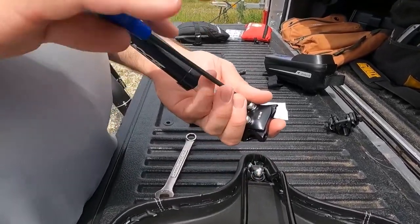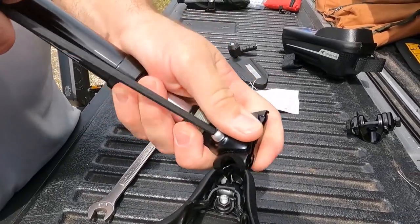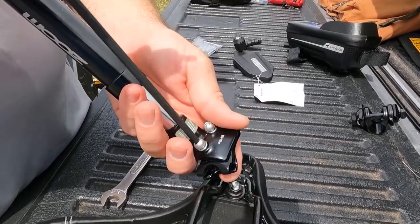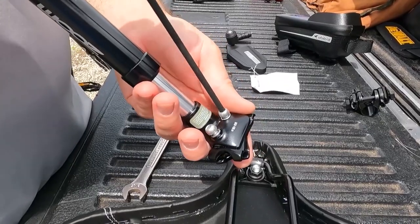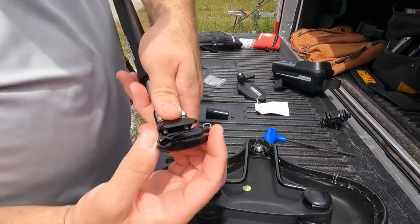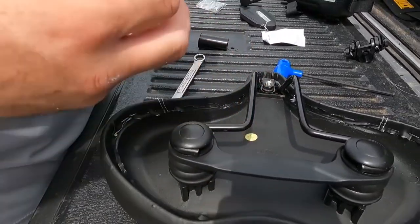See? Bought this for the brakes, but it fits a lot of stuff on this bike. Well, all the e-bikes have a lot of 5 millimeters. It's like a 10 millimeter when you're working on a car. It's like that wrench you can never find. It's always missing. On this, it's 5 millimeter Allen. So we got it loose, and it's adjustable. You can see the ridges there, so you can adjust the angle of the seat to what fits you comfortably.